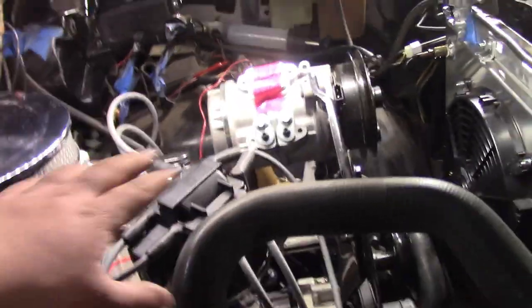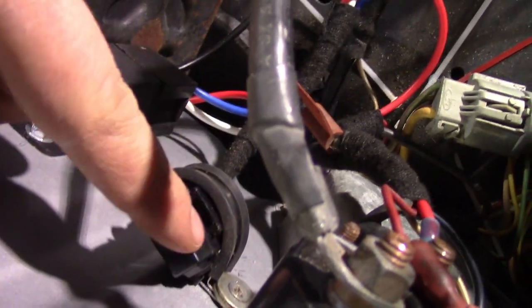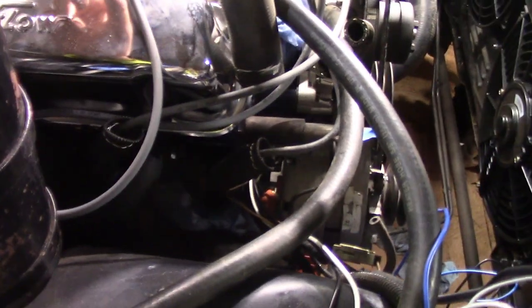We got a lot of wiring kind of temporarily done. So we have that kind of wire nutted over there. That is our ignition source. Hopefully there's not too many things on this ignition circuit. What I have is a signal for this, the fan control relay, and this is the fuse for it. I also have the wire going to this carburetor and the wire going to the fuel pump on the same circuit. So, as long as that's not too much on it, we should be okay.